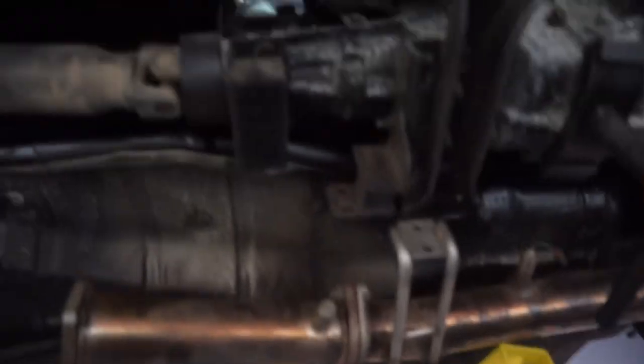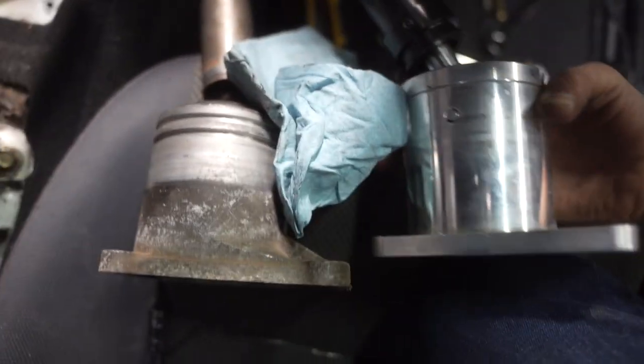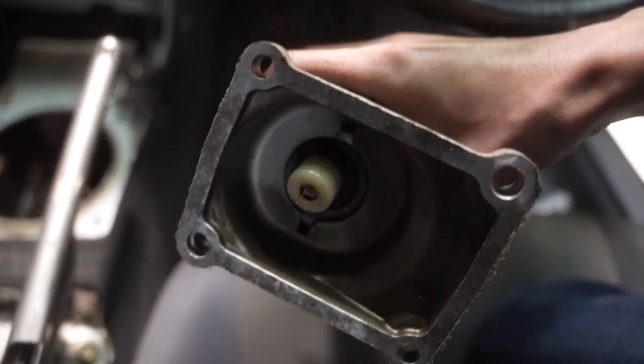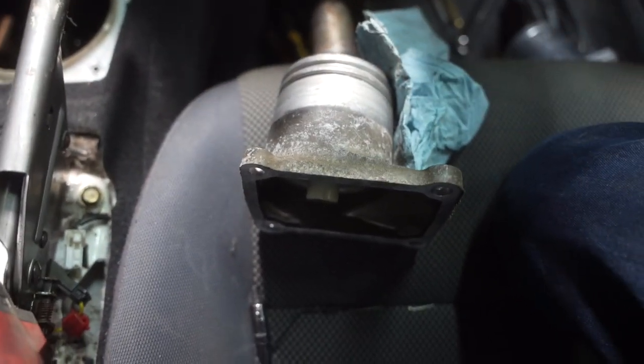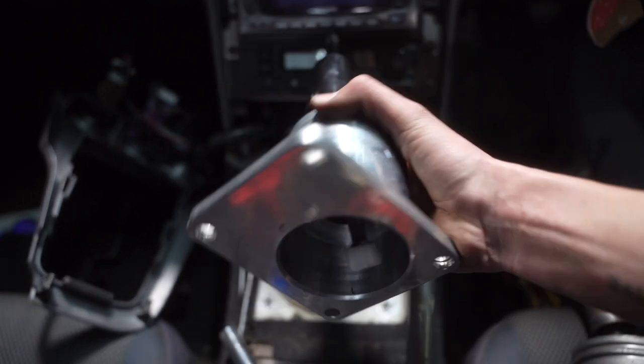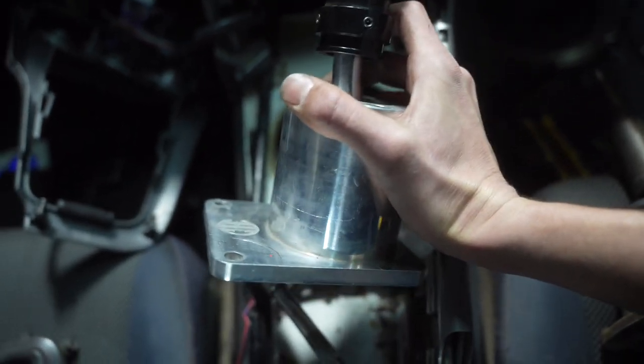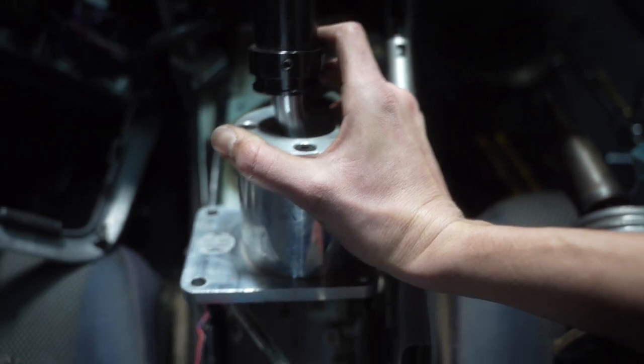The old shifter is out — old one right there on the left, new one right here on the right. It's actually flipped backwards right now. I actually thought this shifter was going to be in way worse condition than it is, like the bushing at the bottom, but that bushing actually looks really good. So I don't know why the shifts in this car felt so sloppy, but not too concerned. There is a gasket here — I wish I didn't have to reuse this, but I don't have one, so I'm just gonna reuse it. The new shifter should have a really nice feeling. I was actually watching a Jimmy Oaks video and he has this one too — I had bought it already and then saw him install it.